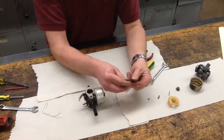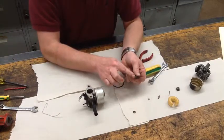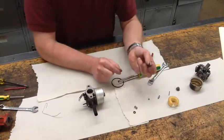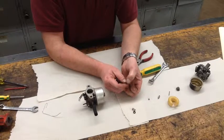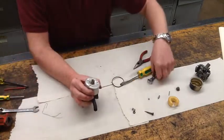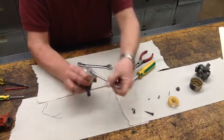When I take it apart, I pull the needle out. You have a rubber O-ring. There should be a brass washer between the O-ring and the spring — on this one there isn't. And then you have your needle valve. When you're looking at the needle valve, it should be nice and smooth; it should not be ribbed. Once we have that out, we can go ahead and take the actual jet out.